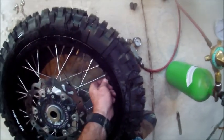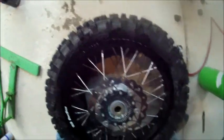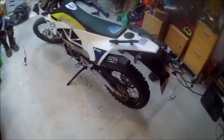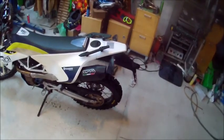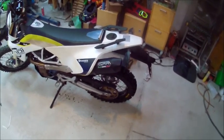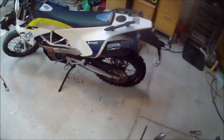I'll go ahead and tighten down the rim lock — pull it all the way down — and then put in my four pounds of air and I am good to go. So there you've got it, we're all done and ready to ride. The only thing I never mentioned is that the tubeless system and even this tire are neither DOT approved. So if having a DOT-approved system on the bike is a concern for you, scratch this one off your list. That's my disclaimer.